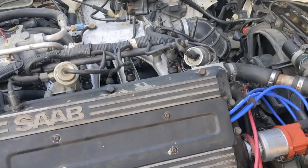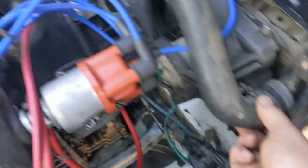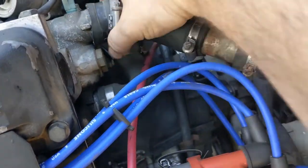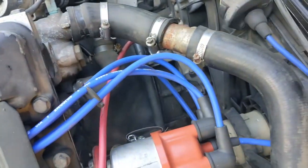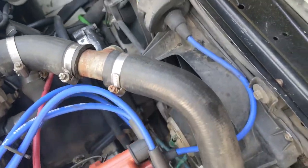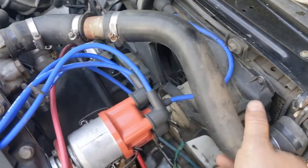Picking up in the engine bay — some really simple steps. Undo the hose clamps for the upper radiator hose, one on each end. If your car has been properly maintained, there'll be an electrical connector here — disconnect that. Go ahead and remove the upper radiator hose and set it aside; maybe there's a little coolant in there still, but hopefully not much.